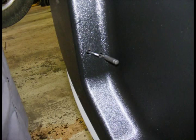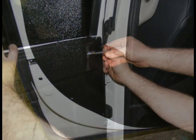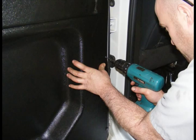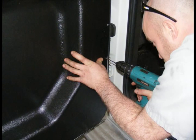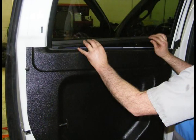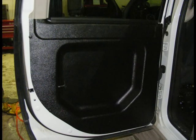Door insert installation. Install door panel by putting lock rod and pull rod through existing panel holes and thread T-handle on pull rod. Install supplied push pins to install panel to the door using existing holes. You will need to drill two additional holes using a one-quarter inch drill bit where factory door holes did not exist. Install remaining two push pins in your newly drilled holes. Finally, reinstall inner belt molding and factory upper trim panel. Your first door panel is now complete. Repeat the process for the second door.